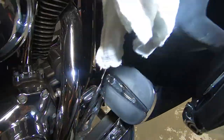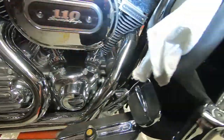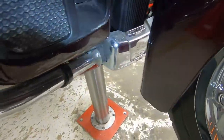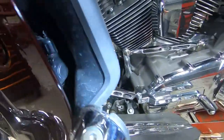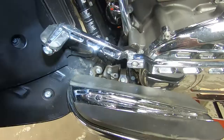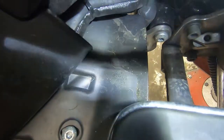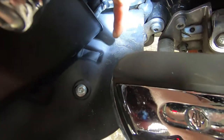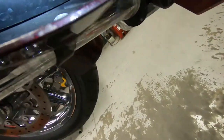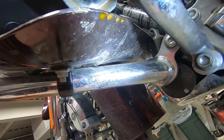The radiators are in the lower fairings and there are coolant hoses that go up around the front, on top of the engine, into the cylinder heads, down into the coolant pump, and back over to the other side. We're looking for orange leakage. I can see something that looks orange right there — this part looks like dirt, but this part looks like it could be orange coolant. Son of a bitch — right there. Can you see it? We do have a coolant leak.